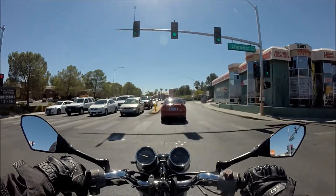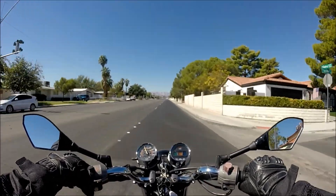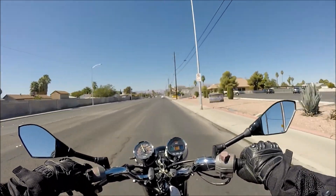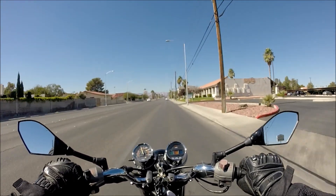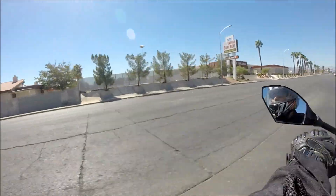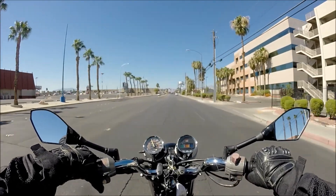These new glasses are actually really good. So, what happens when you put the oil out of the engine in storage — or change it right after you get it out of storage — is that after a few months, the oil in your engine will actually lose viscosity. That's the way oil works: it degrades over time, and it also degrades with use. Once the oil loses viscosity, it can get stuck in certain parts of the engine. For example, sometimes you'll have oil that gets stuck up in your — like say you have an overhead cam engine — it'll get stuck in your head.